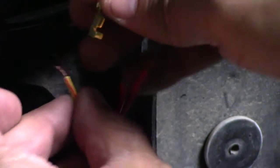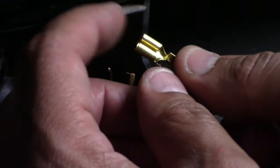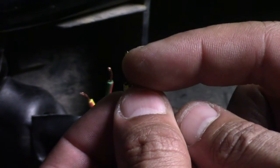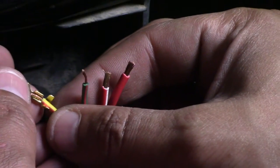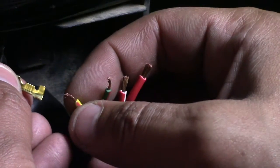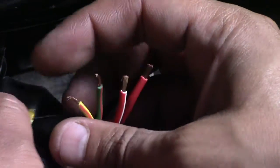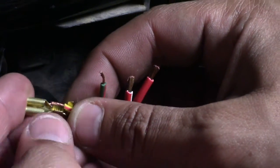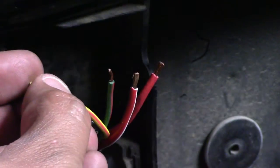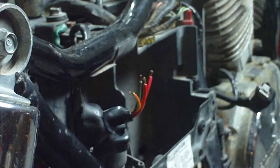These new connectors will actually connect into the plug housing. The most important part when you're doing a job like this: you have the new connector right here — this is what plugs into the plug — and then you have the part that hooks onto the wire. You need to make sure it's positioned so the crimps go across the plastic insulation on the wire, but you still have enough bare wire meeting up in that middle area where the connection is going to be made.